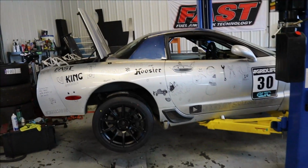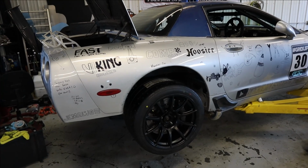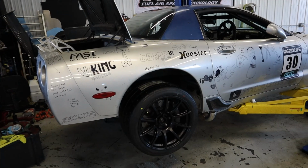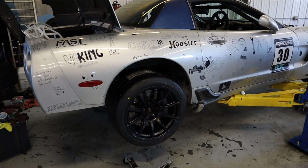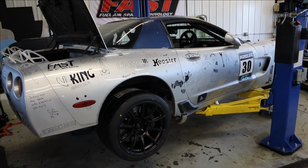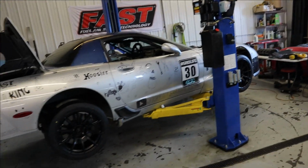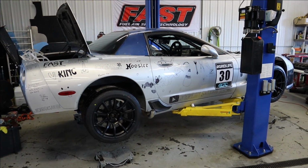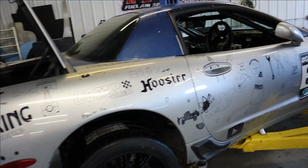And I need 2 sets of dyno numbers, basically. One for these wheels and tires because I can save 4%, although this setup weighs 20 pounds more, or 22 pounds more. So that actually adds power that way too, versus the Hoosiers where I have to take out 4%. So we're gonna make a bunch of different horsepower maps basically for different configurations, and then we can decide what track each should be best suited for.